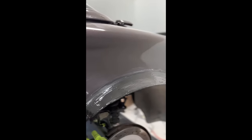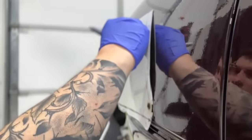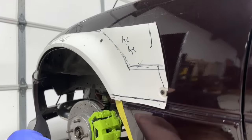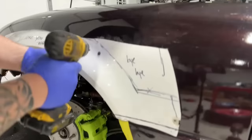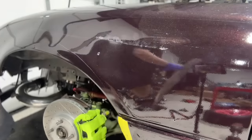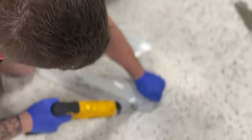Now that the rear was getting there, since the rear was wide, I then needed to widen the fronts. I had E46 325i front fenders that I chopped up lying around. After I chopped them off, I thought the arches were nice — I could bolt this onto something and use a metal wide body, retaining metal instead of fiberglass. So all I did was do some measurements, cut, shape, and make it form a little bit better to the Miata's body.